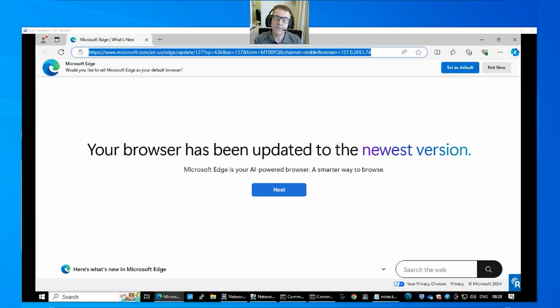All right, so there are a number of ways to initially set this up. You can do this directly connected with a web browser. I like just doing the initial stage here using the Ubiquiti UniFi app on my smartphone. So you need to go and get UniFi Network from your app store of choice and install that. You'll also need an account at UI, at unifi.ui.com. This is where your controller is going to live and be managed.